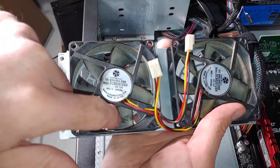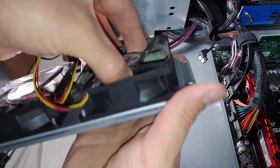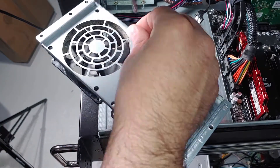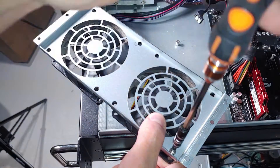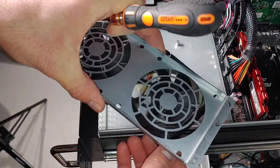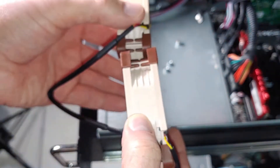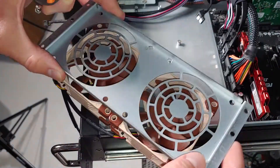These have a rated mean time to failure of over 150,000 hours, and as I mentioned earlier, they're backed by the 6-year warranty. In terms of performance, these fans have a maximum rotational speed of 2000 RPM, and they can push 29.6 CFM at a static pressure rating of about 1.96 millimeters H2O. With two of these fans installed, there should be no issues getting enough air into this 2U case.